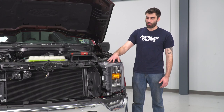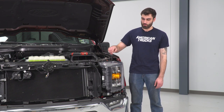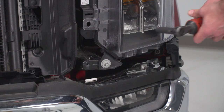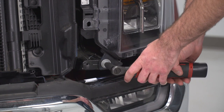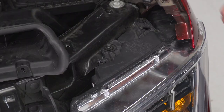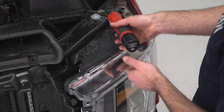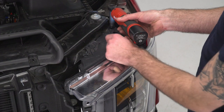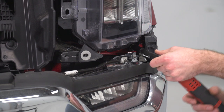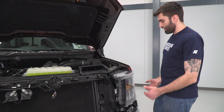Now the last thing we want to do is pop out one of our headlights so that we can wire up our lights on our new grille into our daytime running lights. We have two 10 millimeter bolts and a push clip up top, and then an 8 millimeter bolt at the bottom that we need to remove to pop the headlight out of place. First we'll remove our 8 millimeter bolt at the bottom, then coming up top we'll grab a clip remover tool to pop out our clip and then grab our 10 millimeter socket for our two bolts. We also have one more 10 millimeter nut on the bottom corner of the headlight to remove. With all of our hardware removed, we can pull straight back on our headlight to pop it out of place.